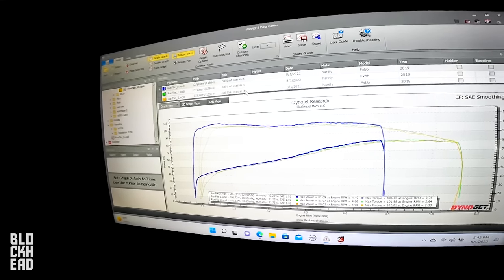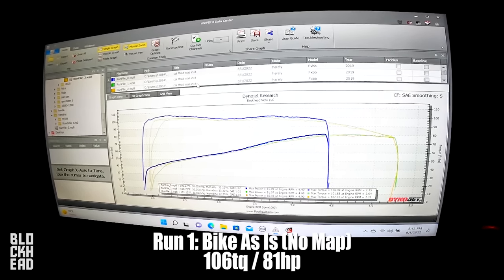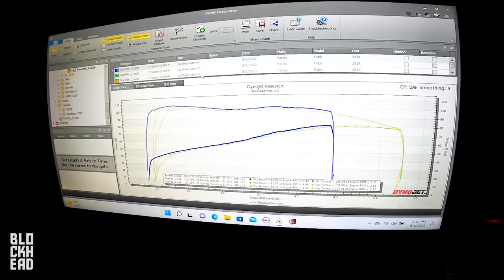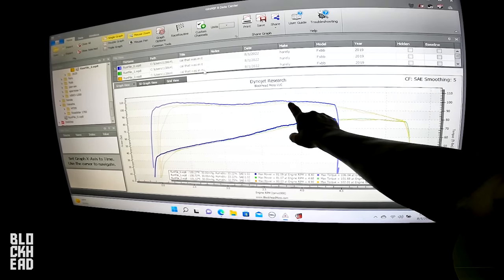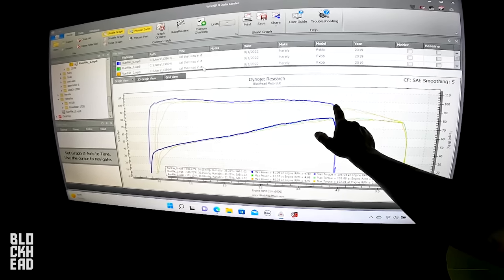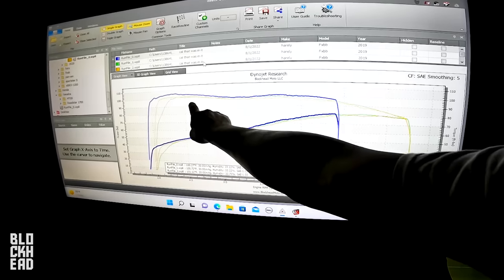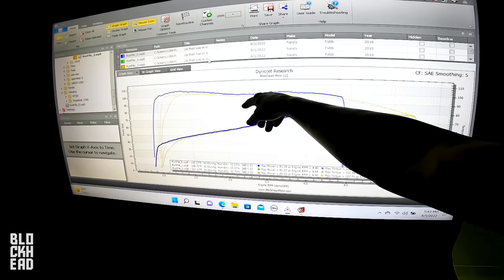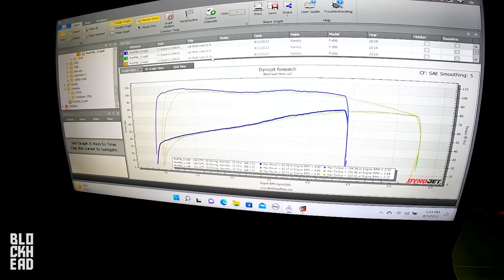Let's start with what's in it and then go through how to find what you need. Where you're sitting is actually not a bad number considering you have a 107 — we got 106.04. That's a six-gear pull, your redline's at 5,200, and your top speed is set at 116, which is why it's cutting off short. But your torque would never really surpass that anyway, so you're already starting to fall off. 106 is a realistic number.